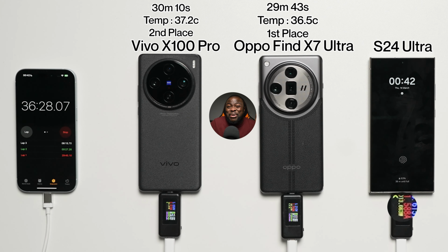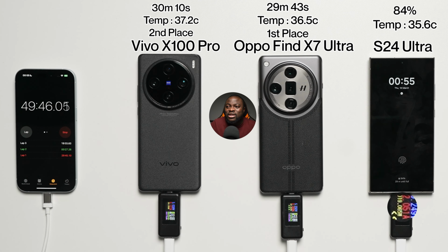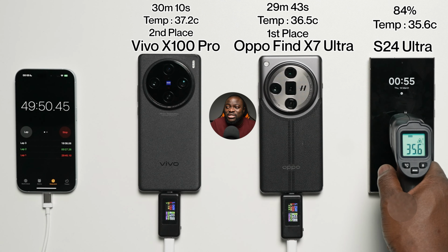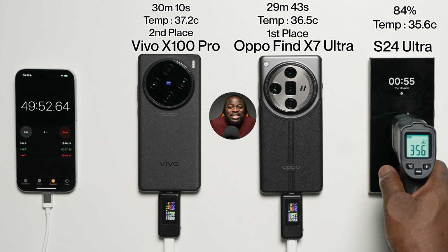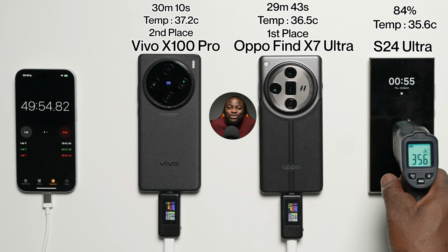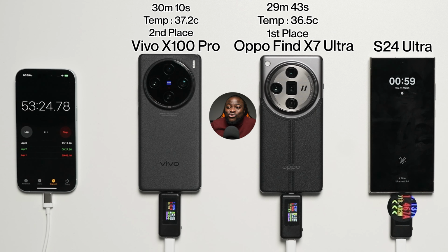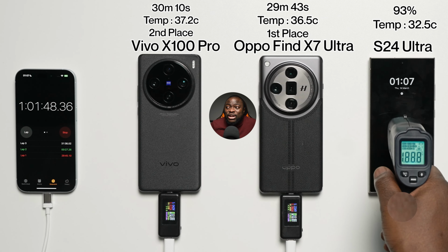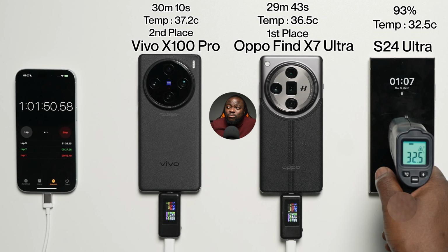Honestly, at this time I was so tired after the difficulty of the battery drain test, and I wasn't really paying attention with the Galaxy S24 Ultra. I've done so many charging tests with it that I kind of just let it cruise. The next interval was just before 50 minutes: 84% battery, 35.6 degrees Celsius. I was just coasting and relaxing because I've seen the Galaxy S24 Ultra charge in as little as 1 hour 8 minutes, or slightly less or slightly more. It fluctuates. At the 1 hour mark, it was at 93% battery with a temperature of 32.5 degrees Celsius.